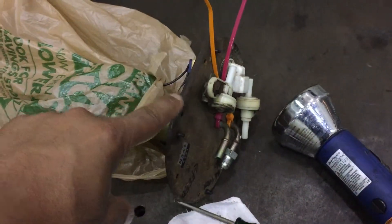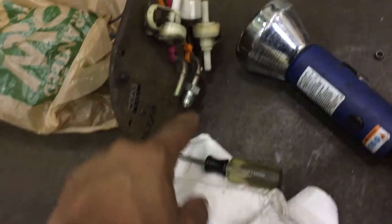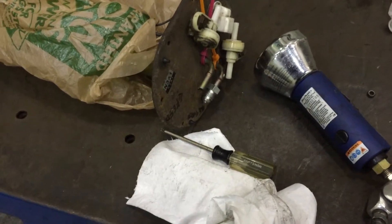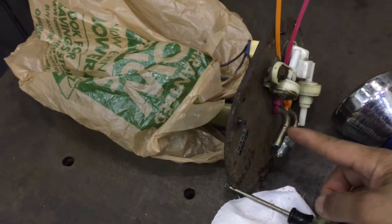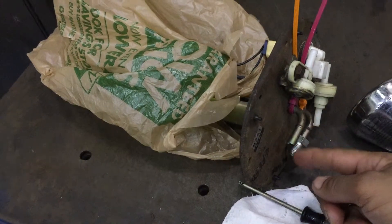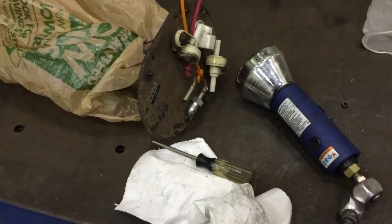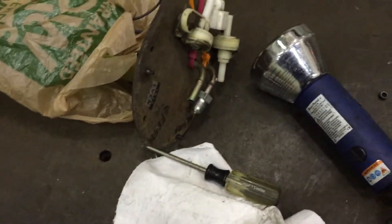What's going on here — this is my fuel pump and this is where it goes to the tank. I've tried everything: I tried the 37-degree flare tool, I bought some of the fittings that supposedly go in the front with a 6AN, and then it squeezes the back. It was not working at all, so this is my last resort.